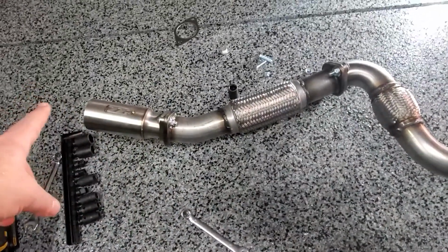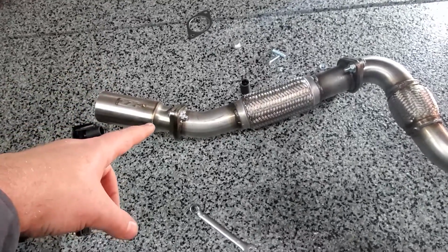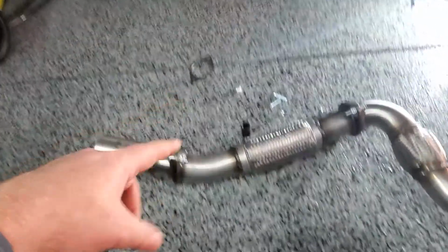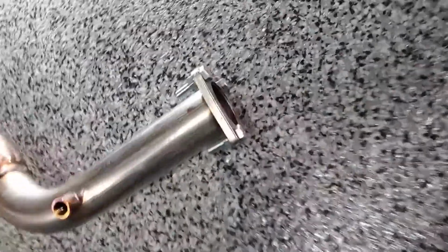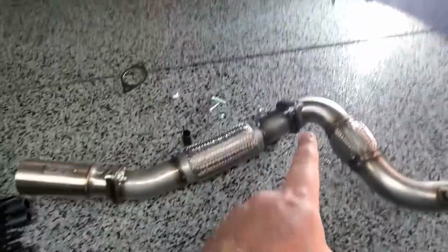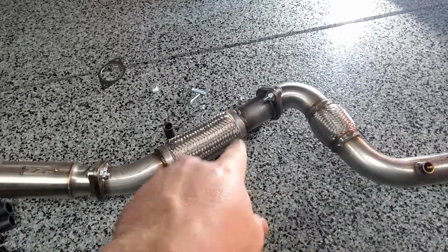There she is, most of my exhaust, minus a downturn tip that I'll just clamp on. I need to have a hanger welded under here. I think I mentioned that before. And don't mind that. I have a gasket there. And there's already one over here. That's just one of the 2 that came with this. I had to use the gasket that came with the big guy, because it didn't line up with the holes correctly on the flex pipe.